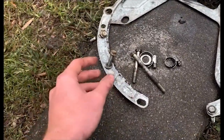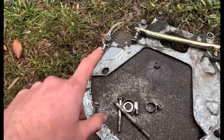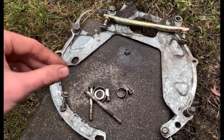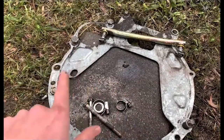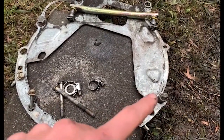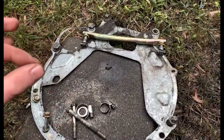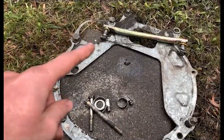And with our transmission, I've actually gone ahead and substituted a lot of the old bolts for, unironically, Subaru bolts. These two here for the starter are from BMW, from the rear diff. They're the same thread, same length. I've made sure everything is the same length, not to bottom out anything or damage anything. Just got to look for the top two bolts as well as these two that come over here. Go to the bolt shop and get some 8.8 grade bolts that have a hex head, because these E-Torx, to be honest with you, I can tighten them and loosen them, but I just don't have the range of tools to make it easy and comfortable. So I'm swapping them out while I'm here, so in the future if I do have to do another clutch, I'm a little bit more prepared because of the tooling I have. I don't really have E-Torx stuff, I've got all hex stuff, so prep for that.